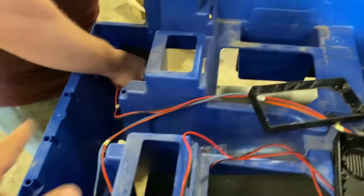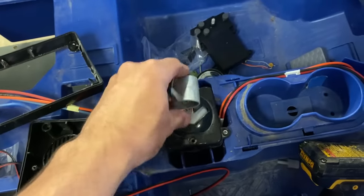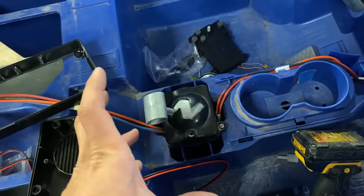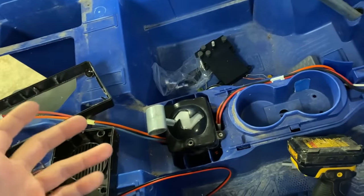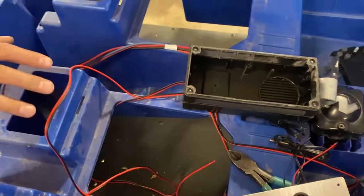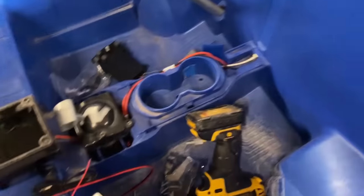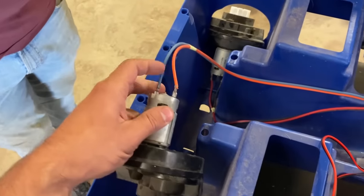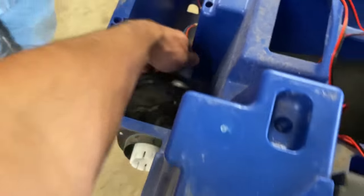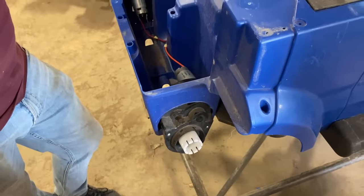These power wheels, when you let off the gas, use the resistance from the motors to slow you down to a stop. Well, if you're moving four times as fast as the power wheel normally would, that would be a pretty abrupt stop. So the brake reduction module makes that less sudden. We've got the new switches in here — those new switches are better optimized for 24 volts. You can use the old ones, but they tend to burn out after a little bit of use. Everything else is pretty easy and could have been done in about an hour. We'd have been done over an hour ago if we weren't doing lights and gauges, because the motors all we've got to do is snip these off, attach the new motors, throw them in, put the axle and the wheels back on, and it's done.